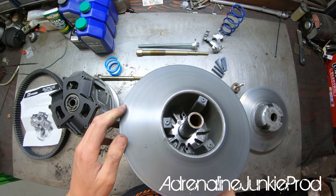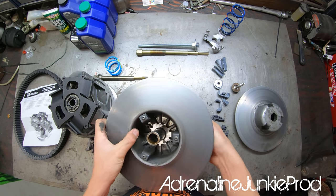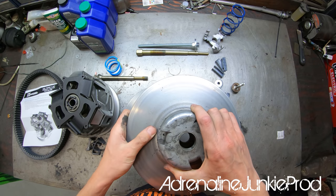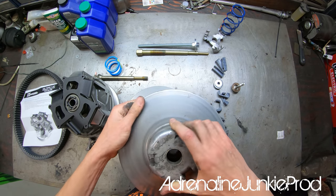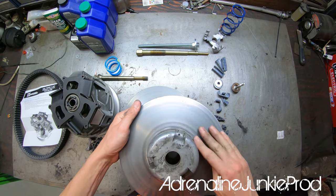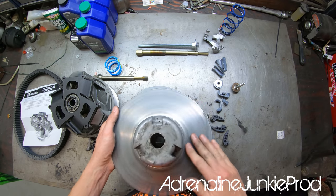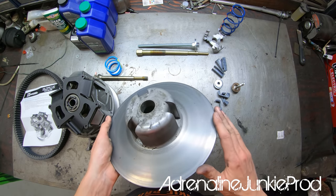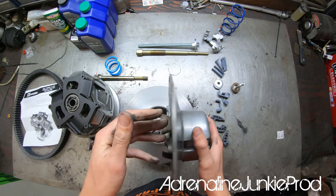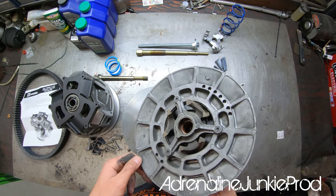Go around your clutch and make sure there are no cracks — these can crack if overheated. My clutches look pretty good, no damage, no cracking, no pronounced ridges. Every time you change the belt you should run a scotch pad across the clutch surface. Don't go too deep — just a nice green scotch pad with a cross-hatch so the new belt has a fresh surface to mate to.